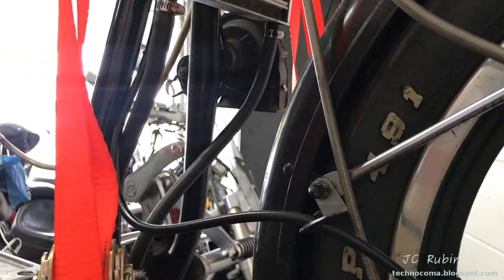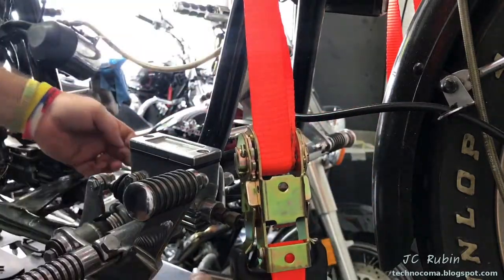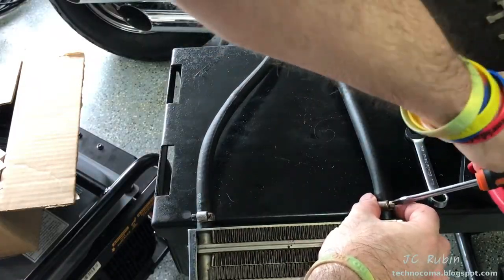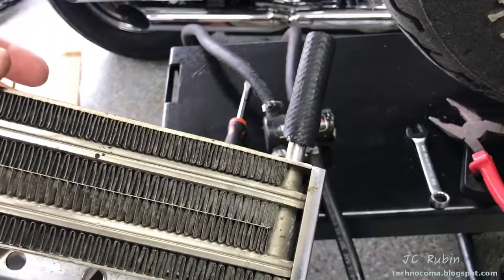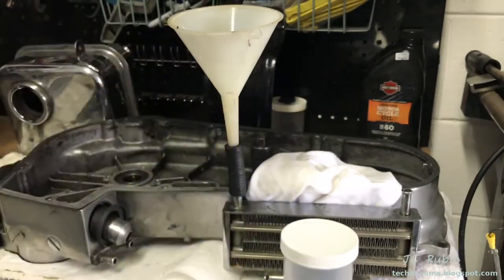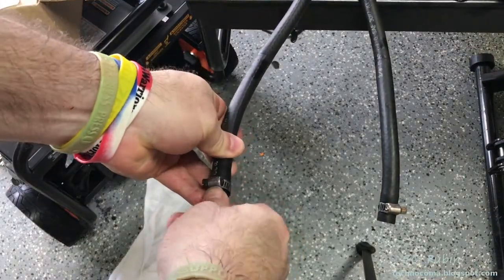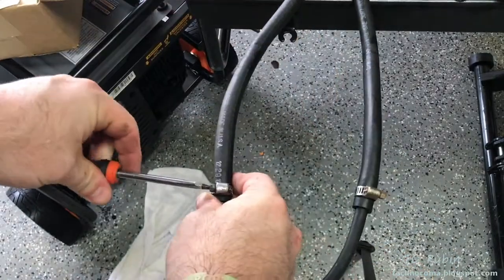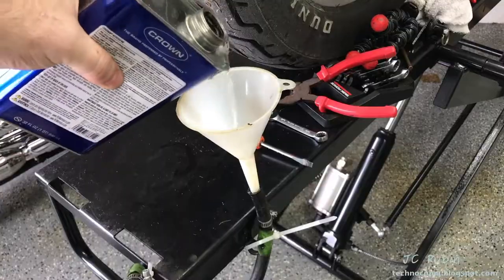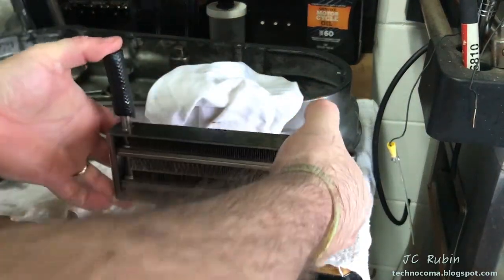I disconnect the cable ties so I can pull the whole unit out, carefully lowering it so as not to scratch the fender. It's removed from the bottom of the bike and I lay out everything on the floor as a single unit. Working with the oil cooler separately, I detach it from the two hoses, add a small length of hose to one end, and stick a funnel in that hose. With the unit propped up I fill the entire thing with kerosene. For the other side I insert a hose where the oil cooler was removed to complete the circuit, buckle it down, and tie off both sides on the motorcycle lift.